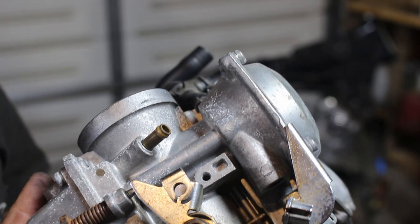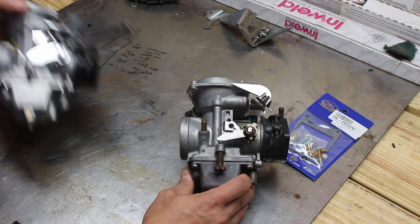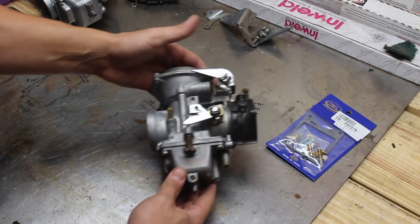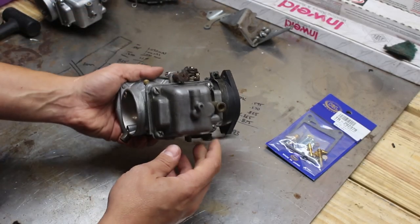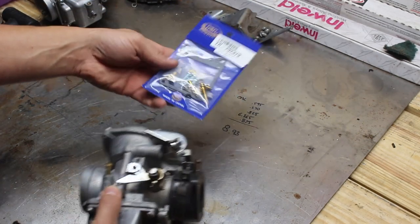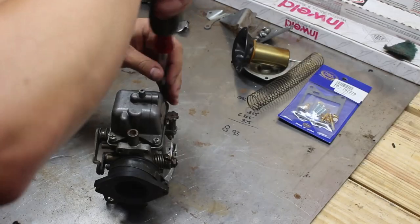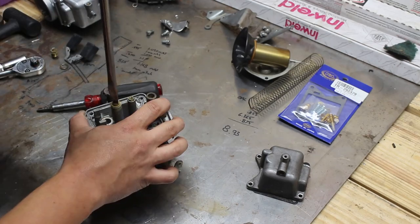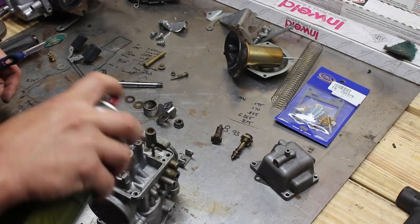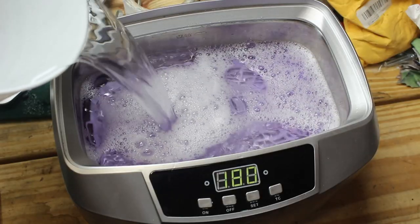I got the carbs off. You can see they're starting to oxidize, so I'm going to clean all that up. I've already done the second one. What I'm going to do is take this apart, sandblast components with more corrosion, and then put everything in the ultrasonic parts cleaner to get everything perfectly clean. I have a rebuild kit ready. I use Purple Power diluted heavily since it can be hard on aluminum — harder than Simple Green. The parts washer is heated, which seems to do a better job.